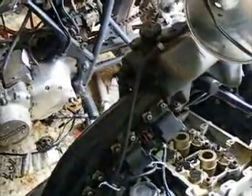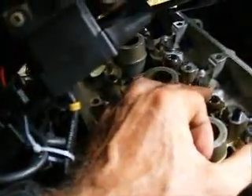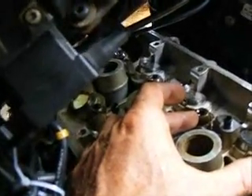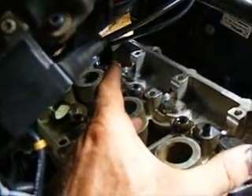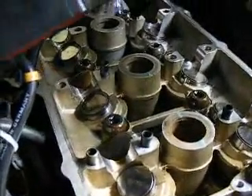I like it a little bit heavy, and that really translates to like 25 or 26 — I'm just doing the math in my head. Go on the internet and do a search if you want to be exact about it. Now, after you're done, you go around them again and you turn them 90 degrees. If you don't know what 90 degrees is, that is a quarter of a turn. Don't guess. Get them all the same — 90 degrees after you've finished your second pass on the torquing.